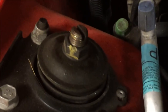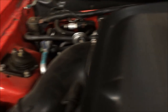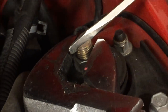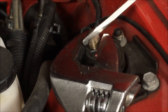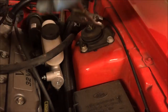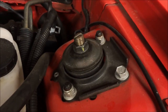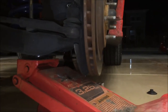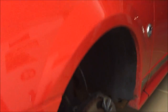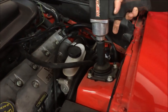When breaking the top center bolt loose, the problem is the whole strut will spin. There's a notch in the top and you can get a screwdriver to lock it in place — 21 millimeter is the size. If you don't have that you could try a big wrench, but since we have an impact we'll just put our 21 millimeter on there. When you hit it with an impact it spins fast enough that the strut usually just stays in place. Position the jack under the control arm to support it, then take off the top strut bolt using small jolts.